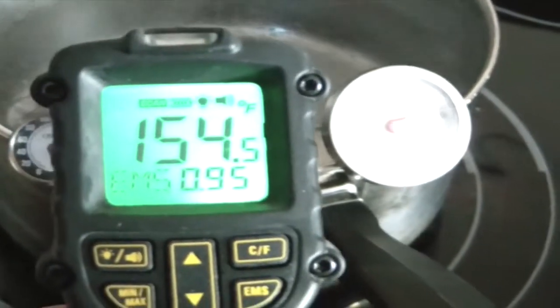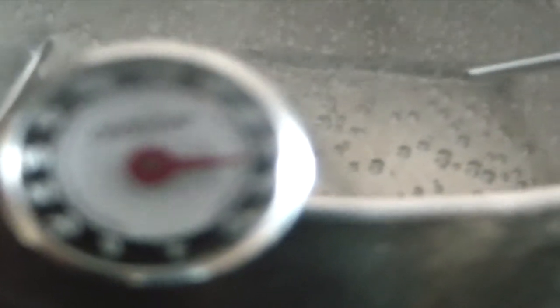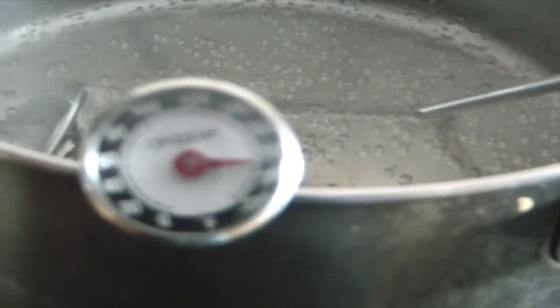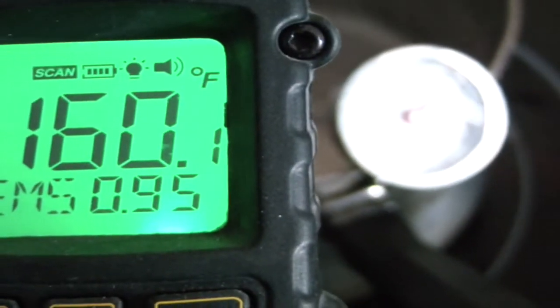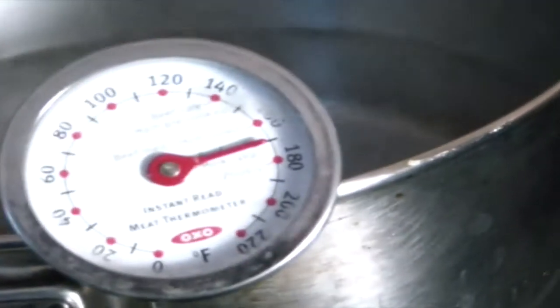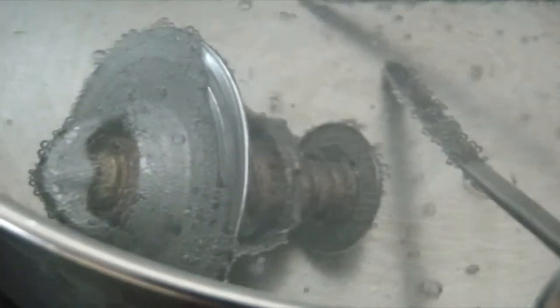150, 160, and 190 — starting to boil. I'd expect it should boil at about 190 at this altitude, but I'll have to check tables. This one seems to be reading just a bit low. This one's now at 170. I don't know what this thermostat is rated — some are 175, some are 190. I think Cummins specifies 190, but this is not a Cummins thermostat.